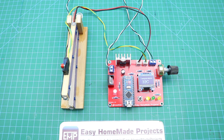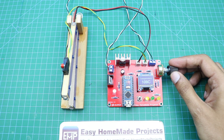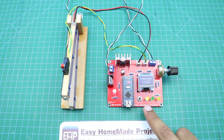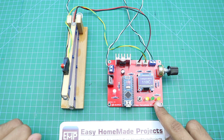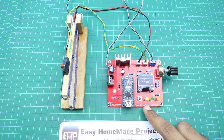After installation of the Arduino code, I connected our machine with a 12-volt power supply and now it is ready to use. First we will need to set the temperature to 110 degrees. There are two modes in this machine: pulse mode and continuous mode. You can switch between them with the mode selection button. In continuous mode the heater stays on always, while in pulse mode the heater only heats up when we press the limit switch — in my opinion, pulse mode is very accurate.